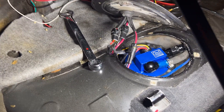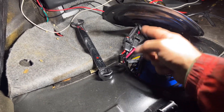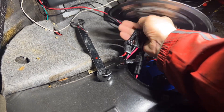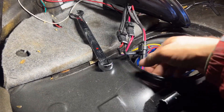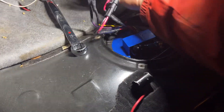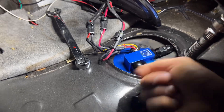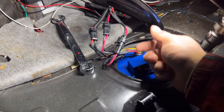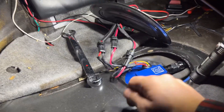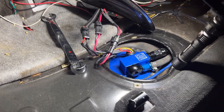It's all wired in on this side. I have the plugs in — make sure you wire the plugs underneath the hat because it'll be really hard to get it out. I'll add some slack and tuck the wires in so I can shut it nice and flush. The less wires you have bunched in there, the better. I'm going to do a test run to make sure it fits. The way I'm going to test the secondary pump is just turn the key on — I hear the pump running, great — then I'll switch plugs to switch what the primary plug is, turn it on again, and if I hear it prime, I know the pump is working. The secondary pump is not going to kick on until the ECU sees two pounds of boost.